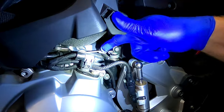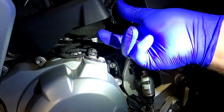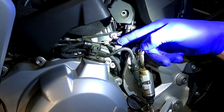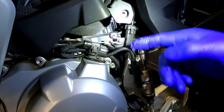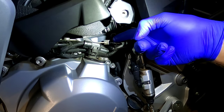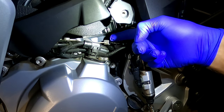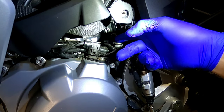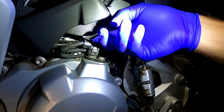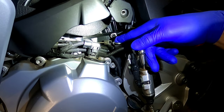I'm shining the light right there — you can see where the cable is. I'll move the clutch and you can see that little actuator right there. There's the clutch. My theory is either the clutch is bad or this cable is too tight, therefore always keeping the little lever a little too far this way and not allowing it to go all the way back. It's not as tight as I would have hoped, but it is sort of tight. We'll loosen it up and see if it has any more play going back.